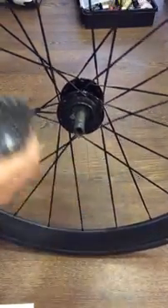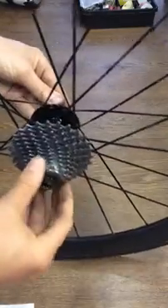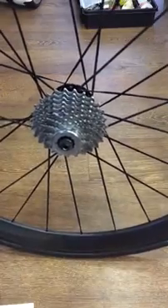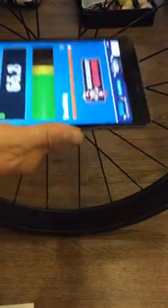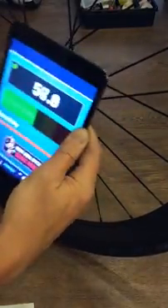Replace the cassette - magnet's still in there. I'll spin it around so I don't actually know where that magnet is. Take our detector - without the wheel there, normal reading is 45. Start passing it over the hub: as you can see, easily getting a reading into the red, and I'm still 50 millimeters from that hub. Take it around this side - not so strong but still getting a reading. Take it from this other side - wow, that's obviously where the magnet is, but it's picking it up from all sides.